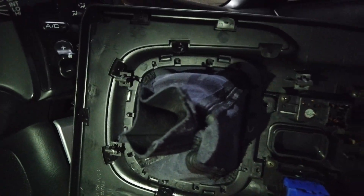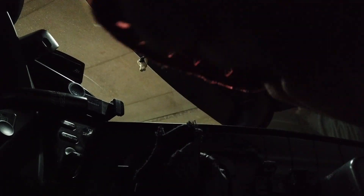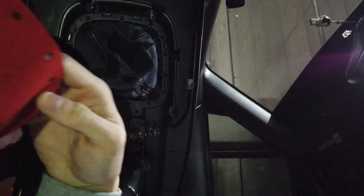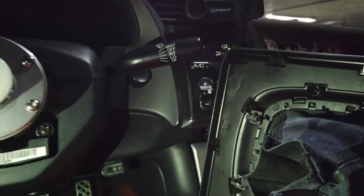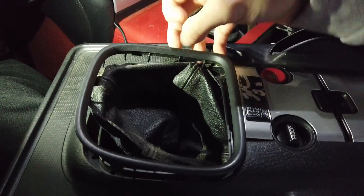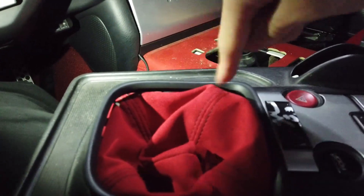You're going to want to take notice of which side these two flaps are on, because you'll have to install your shift boot the same way. You're going to have to match up the holes. The two screws you removed are for taking out the shift boot holder itself. There are six tabs on the edges that hold the shift boot in — once you pop this out and up, the shift boot should come loose. There are three pins on top, four pins on the sides, and three pins on the back that you need to match all your holes to.